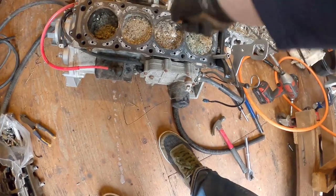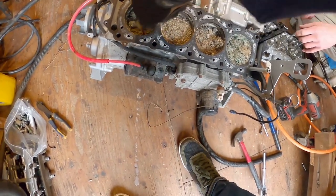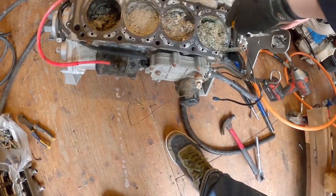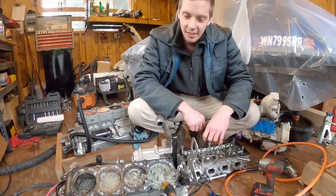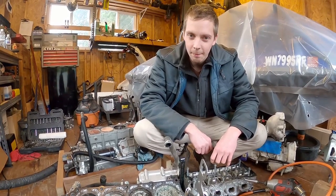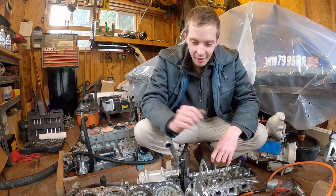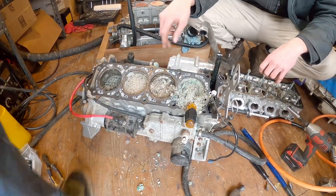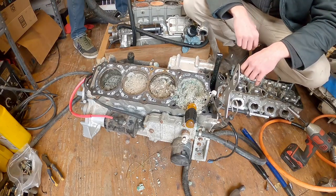Yeah, yeah. Ah, they'll clean up, yeah. I'm assuming that this particular design is very susceptible to filling up with water on the hose or if you tow it. Yeah, that makes sense. I feel like people leave the hose on for 5 hours when they run them, and they think it's like an outboard. Yeah, your ski has to be running if the water is turned on your hose. Yep. Otherwise, stuff like this happens. Not the same as an outboard. Yours might be just as nasty, but mine has no covering of liquid to hide. No, yeah, exactly. Somebody was trying to help mine at some point. Yeah. Yours, nobody's been helping.